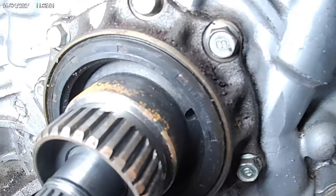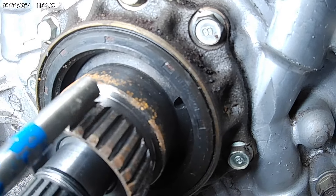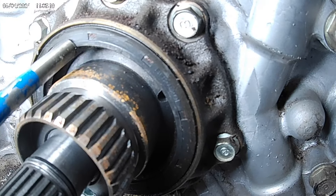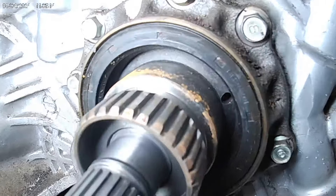When that tension ring comes off and you don't see it, and you install the torque converter, you can't see that the tension spring has popped off. You are not going to like the results when you put it back together.